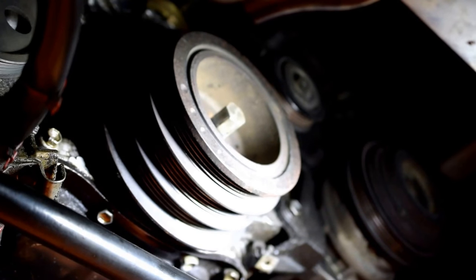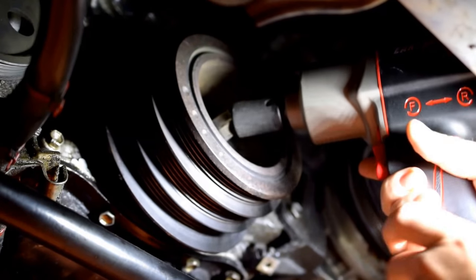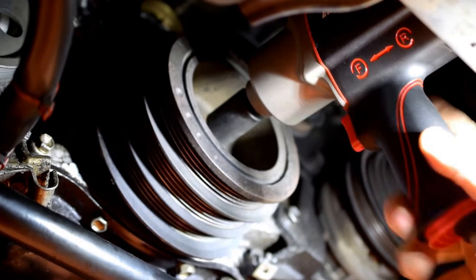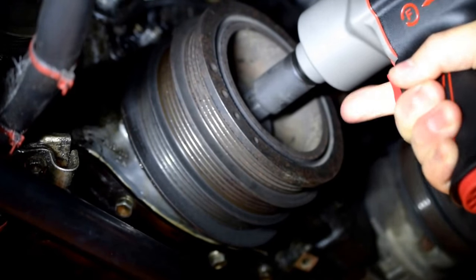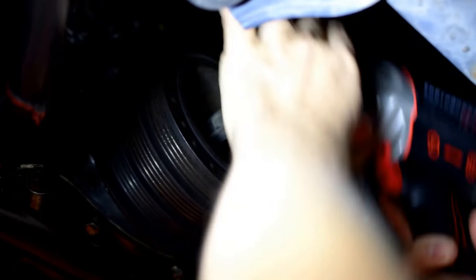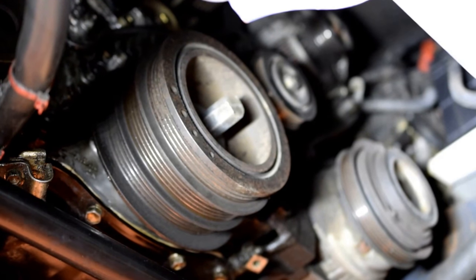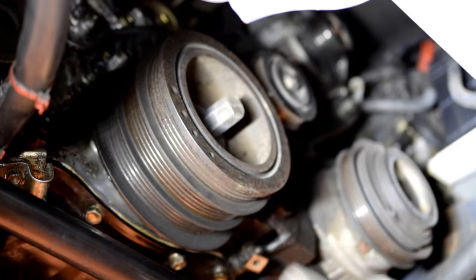The Cobalt did not break it loose whatsoever — not even close. So I got a Harbor Freight Earthquake XT. This thing is supposed to have about three times the torque, so hopefully this is going to break this puppy loose right away. And there you go — that is awesome. That is what you need. This has roughly 1,000 to 1,200 foot-pounds of removal power, where the other one had 370. So there's a difference.